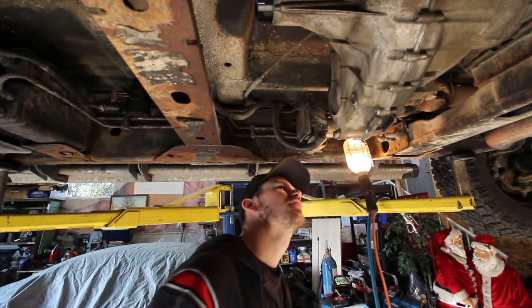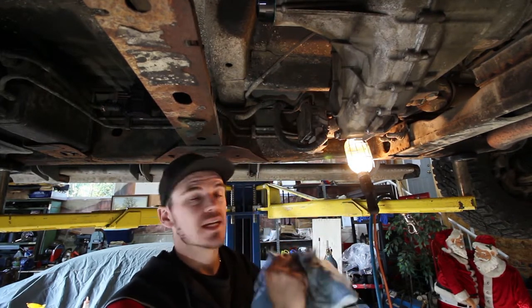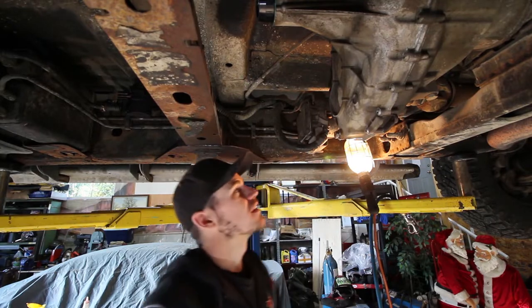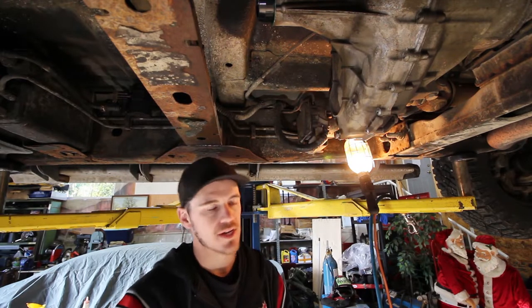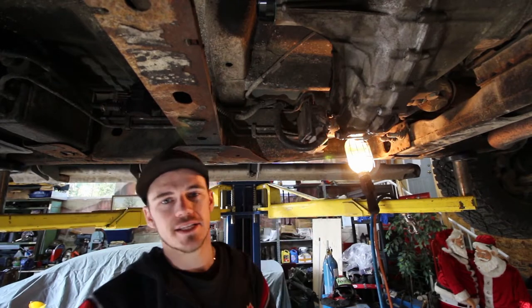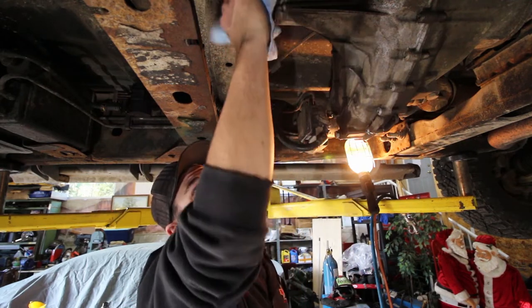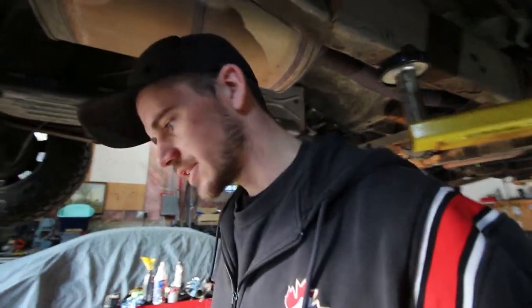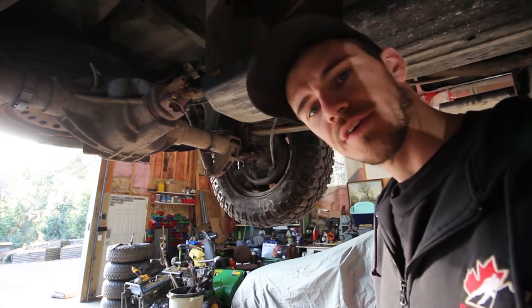This one's tapered but I'm gonna have to give it a shot - just gonna put the old plug back in. I've added the fluid back in. I put as much back in as I could. I'm gonna have a look and see if I've got any more ATF because that looks like what's come out of here. Seems to be holding. I topped it up with some ATF - not a pretty weld, but it's holding. I'm going to put the drive shaft back in. I'll take some Scotch-Brite and polish up where the seal rides, just to give it a fresh surface rather than the old worn groove.